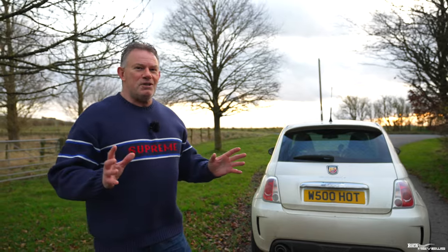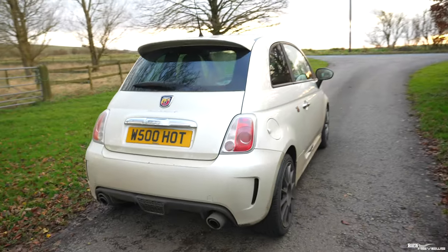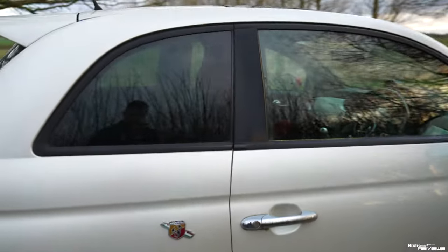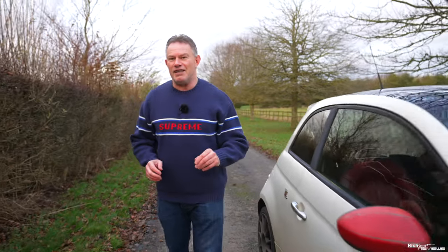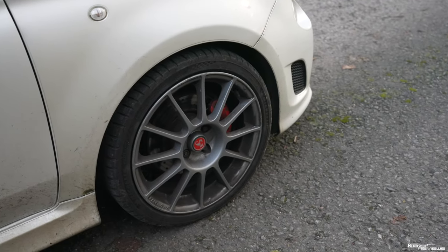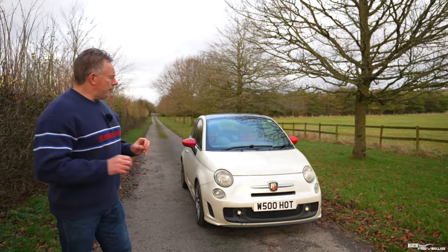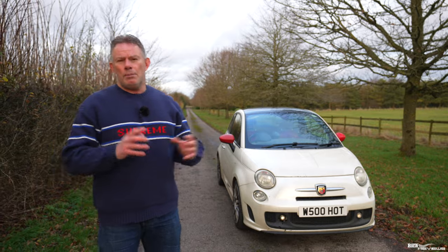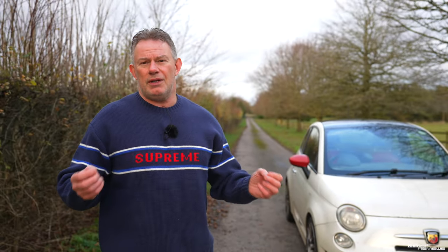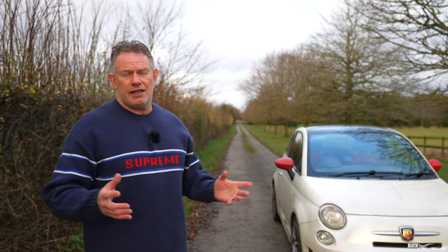Clearly it doesn't look brand new, but you will notice it's been washed — so it's had a bit of a clean and I'm going to try and keep it cleaner going forwards because it does look a lot better. This car doesn't get the love — the 458 gets the love of course — but it is maintained. The car hasn't been serviced yet but I've got all the service kits, so I'm going to service it myself: oil, oil filter, air filter, pollen filters, et cetera. It's already had the brake fluid flushed through because, as part of fitting the new rear axle, all the brake lines had to be bled — so all the brake fluid was flushed and renewed at the same time, which was more cost effective to do then. The servicing I'll do myself and we'll try and bring you along for that service too.